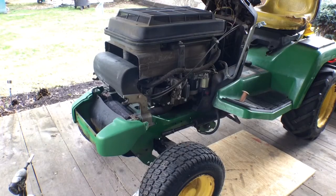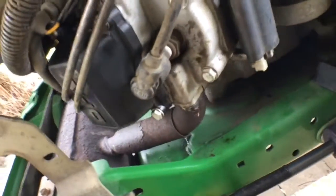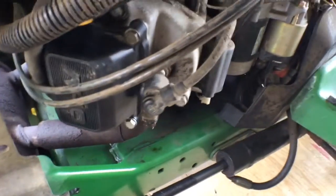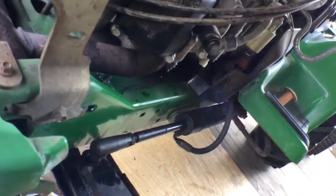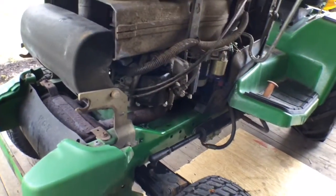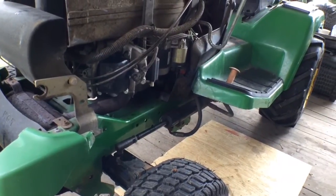Okay, so the tractor now has sat for, I don't know, 15-20 minutes. No leaks, as you can see or can't see. So, double gasketing apparently worked in this situation. 53 inch-pounds, I'm telling you, feels like nothing. I think my granddaughter could easily manage that. Well, for how long we'll see, but seems to be good.